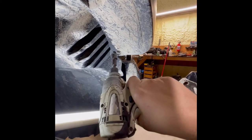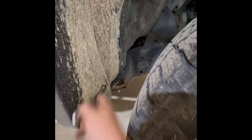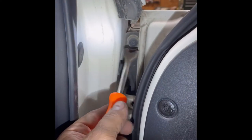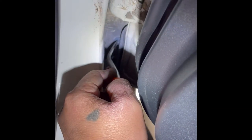Now you've got to get the fender liner out of the way, which can be kind of a nightmare. I'm taking off these bolts because they hold on my fender flares, and then there's one down here I couldn't get the gun on, so I used a ratcheting end wrench. This little panel between the door and the fender is a nightmare to get off — there are some little push-in pins that come out easy, but you have to get that piece out of the way to get to one of the bolts that holds the front fender on.